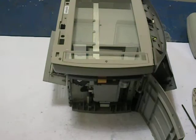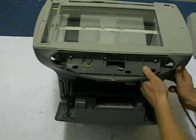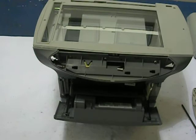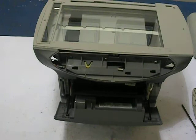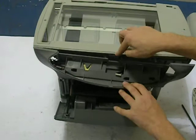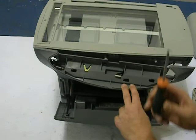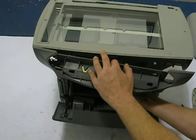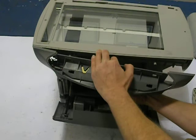This is such a common problem. There is one screw that is the most difficult to remove. Without taking apart the whole assembly, what we're going to do is use a flat blade and remove that front access cover on both sides. We have to get in here and kind of bend it back — it's held down with a couple of hinges at the top and the bottom. There's one screw right where my finger is, and you have to come in with a small Phillips from the bottom side. We're going to cheat the system here and not rip apart the whole machine. This is the last screw that holds the lid assembly, or the platen, on.